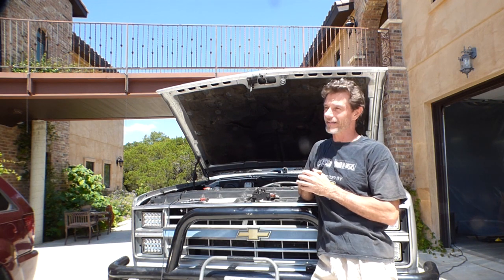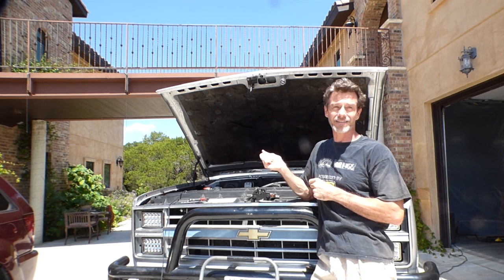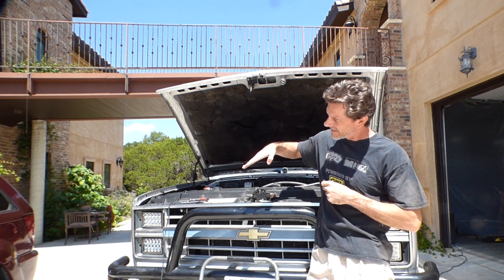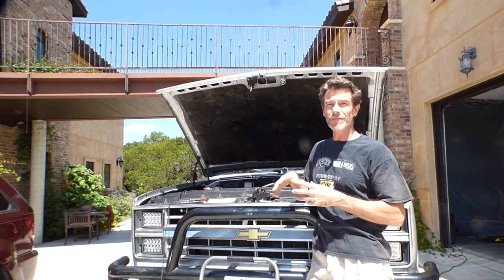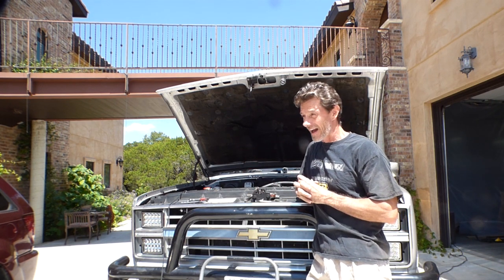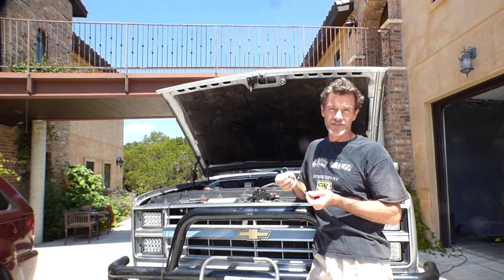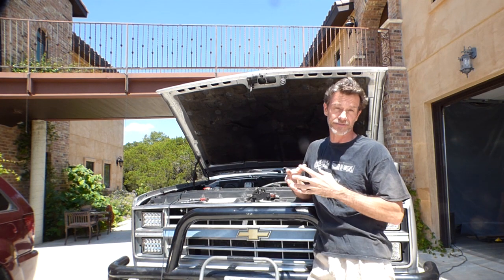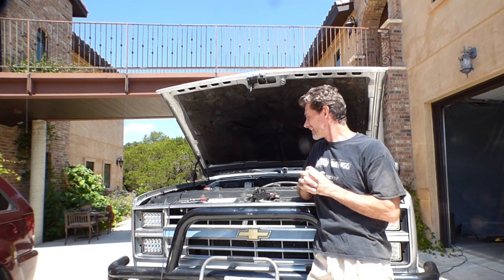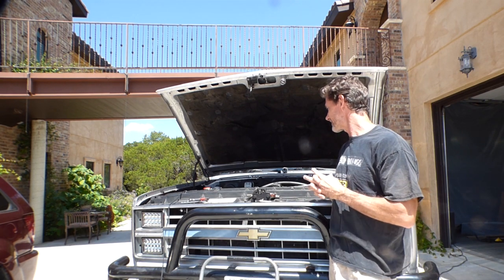We have been parking the Suburban on a hill facing downward, because it seems to kick off a little better than when it's facing upward. So I knew the lift pump was getting weak. I knew that the valve in there wasn't keeping pressure. There was some drain back into the fuel tank. So I knew that the lift pump was going out.